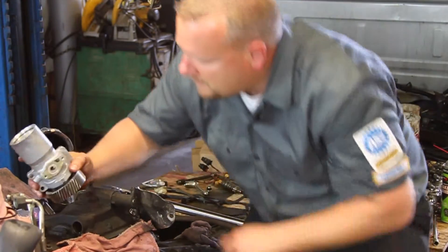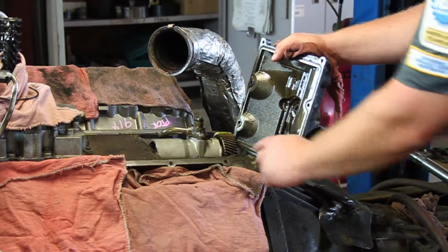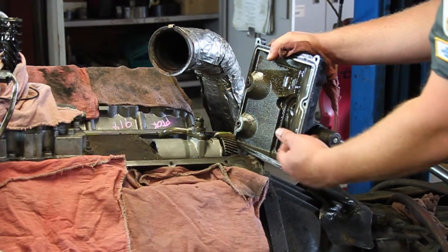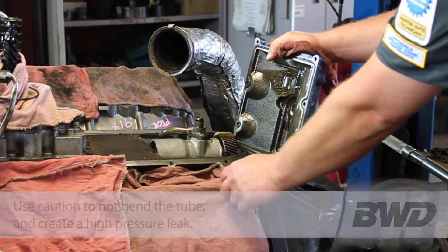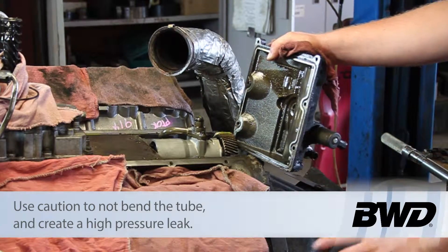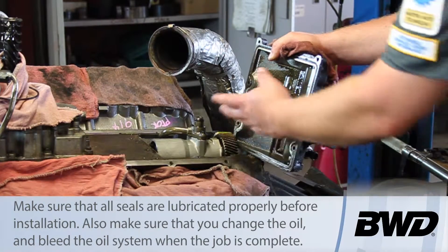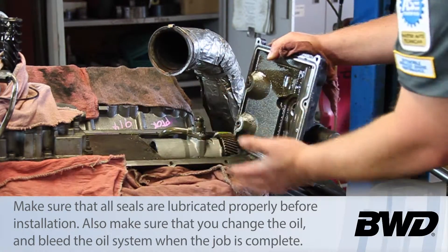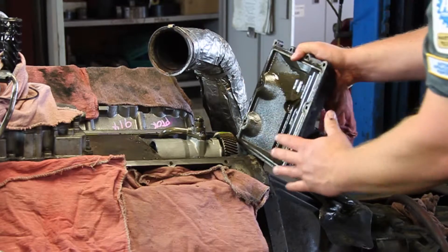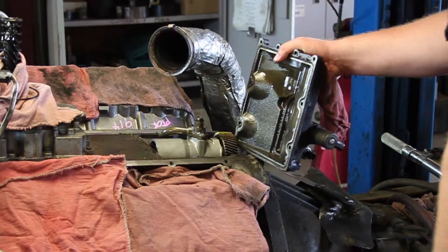Let's get this cover off. We've now got the cover off, and you'll see there's a little bit of silicone here where the rear cover of the engine meets the engine block. We're going to clean this up and replace the gasket in here. We can see the old pump — we've got to pull the high-pressure line off and swing that out of the way. We want to make sure that we don't bend this in any way, shape, or form, otherwise that might result in a high-pressure leak, so we want to be very careful. We'll put new O-rings and seals on this, install our new high-pressure pump, reseal the cover, put it down into place, and we're really done with this part of the job.